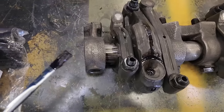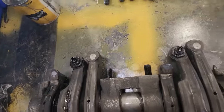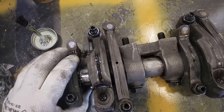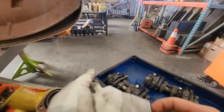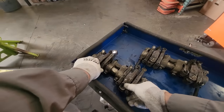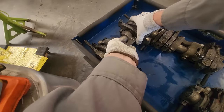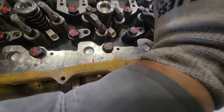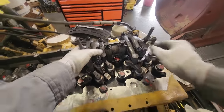This was a platinum kit, so it came with new hold-down bolts. I cleaned all of the shafts for the rocker arms and the rocker arms themselves. The reason I'm putting oil between them is because this is the last place to get oil when starting a new engine. I'm going to pressure prime this before starting, but it's a great idea to put oil between the rockers and on the shaft. We're reusing the rockers — this engine got a new camshaft, new cam bearings and lifters, but the pushrods and rockers are fine. I've never actually seen a broken C13 rocker arm.